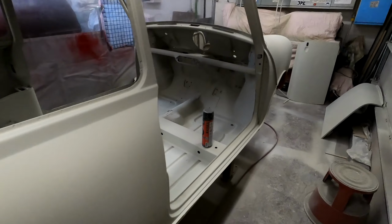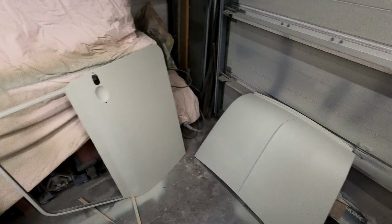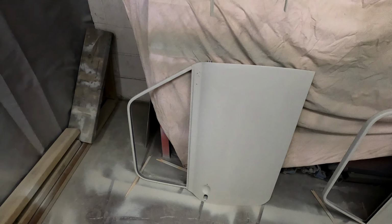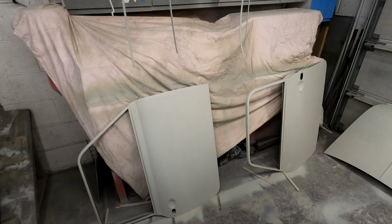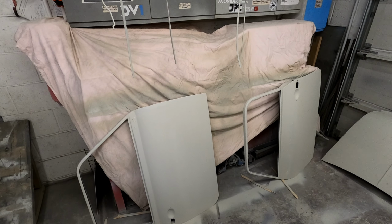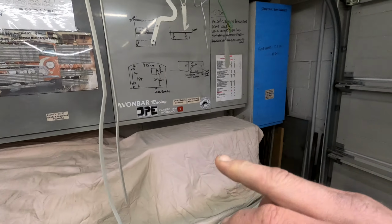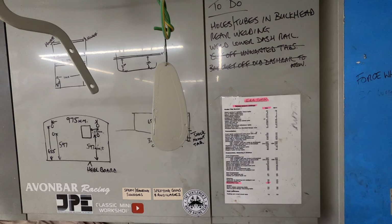Yeah, so really pleased with how it's gone, and I managed to get the bonnet done, both inside and out. A bit of a pain. Doors are all done inside and out, and the boot. The doors were actually new, a newer addition to the car when I sandblasted it, so I've just rubbed them back and given them a coat over with the epoxy primer. I managed to get the bonnet prop done, the seam strips, the bonnet hinges and the bonnet catch, and that little thing that goes on the right hand side of the grille.